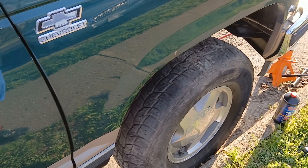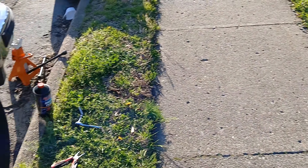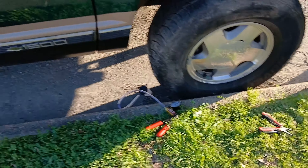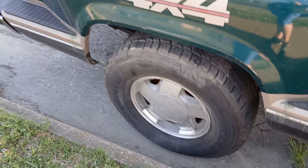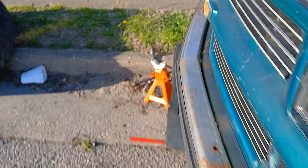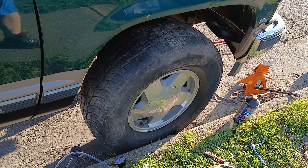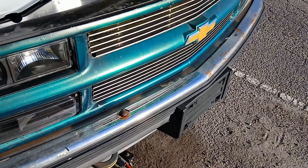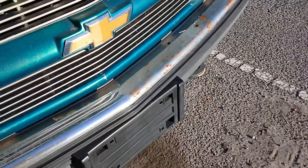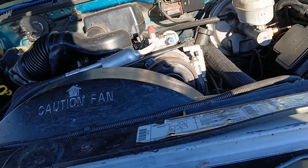The plan is to get a little bit of brakes and then try to start the truck. If it starts I'll pull it into the parking lot, put the rear wheel cylinders on, and then bleed the brakes again. I think she's good to go — just need to see if it'll start up and move it out back. If you want to know if this thing starts up, make sure you subscribe because I'll definitely be working on that next.